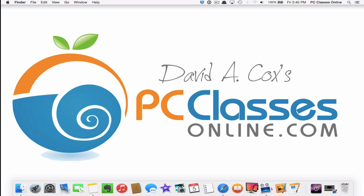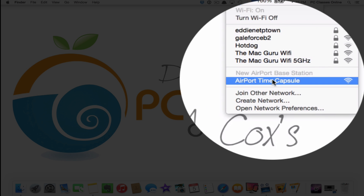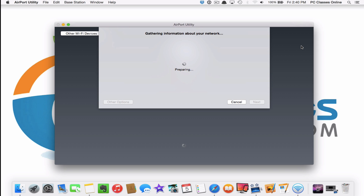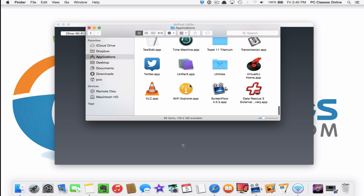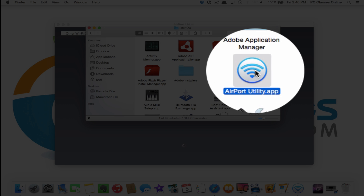Once you've done that, you're going to need to wait about a good minute because these things boot up just like your computer. Once that's done, here's what you do from the Mac. Go up to the wireless icon at the top right of your Mac, and you should see it says Apple Airport Time Capsule — click on it. That is going to launch something called the Airport Utility. Should you ever need to come back to it, go into Finder at the bottom left, then the Applications folder, then Utilities — Airport Utility is right up top.